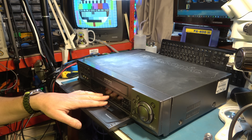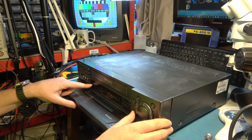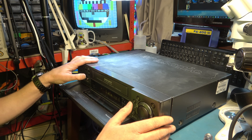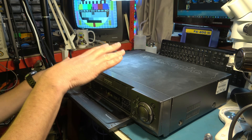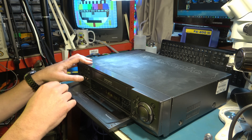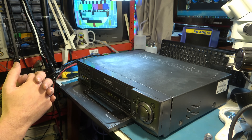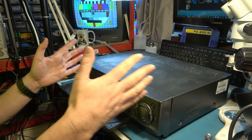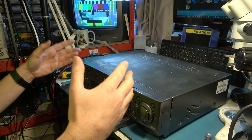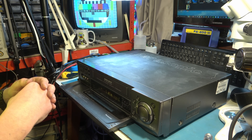We have good picture and stereo sound. This particular tape's a little noisy — there's a 3DNR feature you can switch on which reduces the noise a tiny bit. I do think that in general the NV-HS950 on some tapes with a little more grain can give a slightly noisier image than something like the NV-HS930 we were working on earlier. It's something to do with how they've set up the bandwidth — some machines can tune how much video bandwidth they extract from the tape depending on noise or RF signal quality. But that's working fine. I hope you've enjoyed us working on these two machines. I'll do plenty more content on audio and video technology in the near future — bye for now.